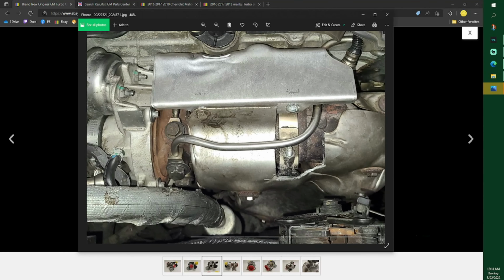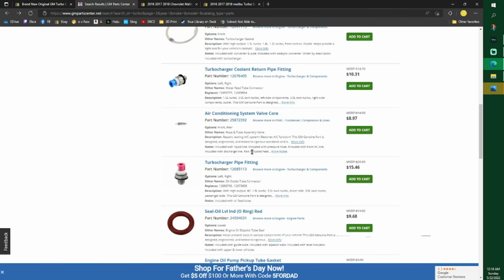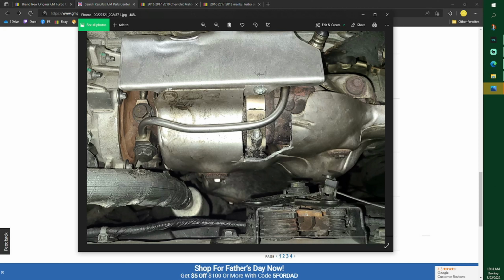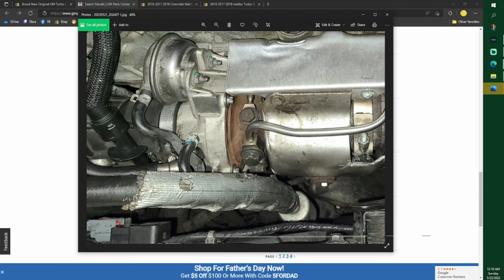I haven't put the washer on that one yet, but I have the stainless bolts going now. If you do use stainless, just use the reference on here for what the bolt is. Oh no, I went to Menards. It's like a Home Depot, and I used their little metric bin and got the exact same bolts. They were like 68 cents a piece, but you can't tighten down stainless bolts as hard because they are a softer bolt and they will break.